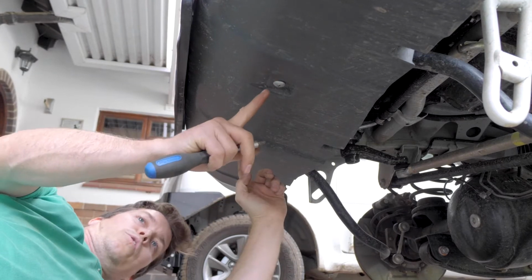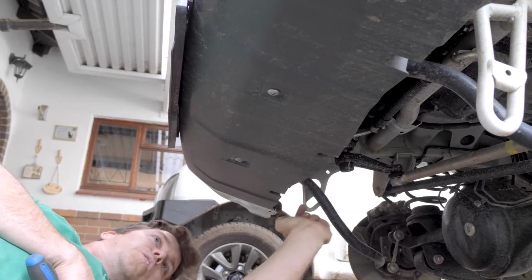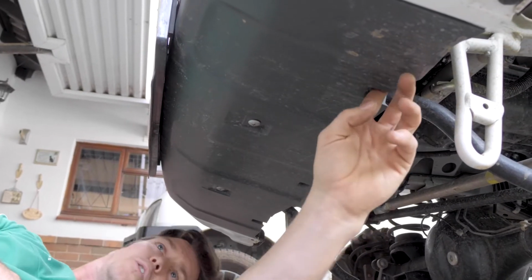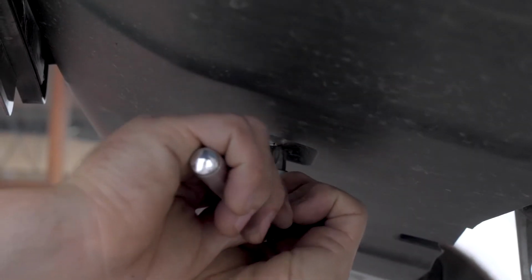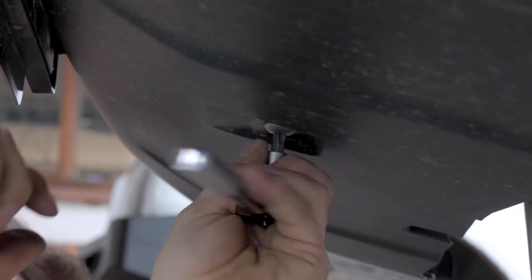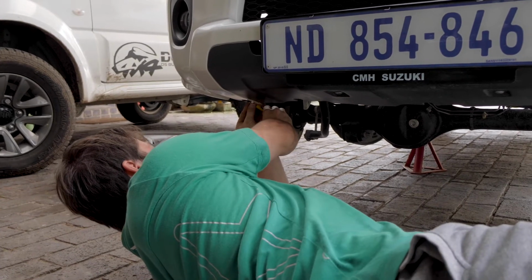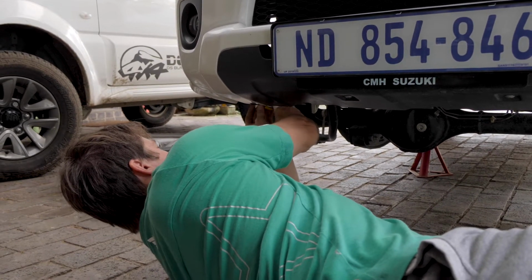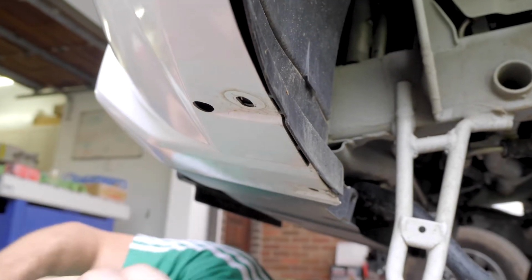Okay, so we've got these two front Phillips screws that we're going to be undoing, as well as the three sitting just further back, holding your plastic scrub plate in position. The screws should all be relatively easy to loosen. So we're just going to undo these two driver's side body clips. They just secure the bumper onto the plastic inner fender cover.